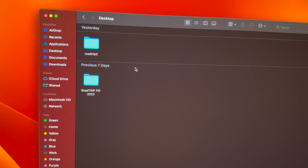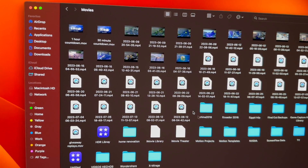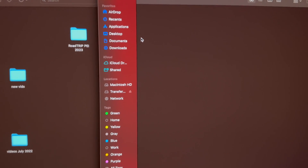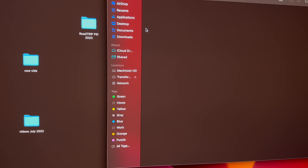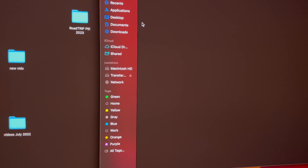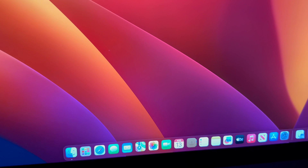Right now you can delete anything, and once you fully delete those files you'll be able to boot up your Mac again without any issues. Delete anything that's taking up a lot of space — as much as possible. I'm going into Movies to delete a ton of stuff. Always empty your trash when deleting files. You could also back files up to a USB stick or external hard drive before deleting them from the computer. Free up at least 50 gigs and you won't have problems logging back in.